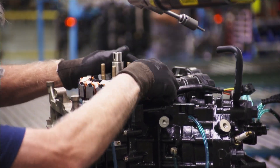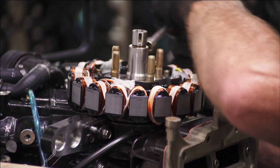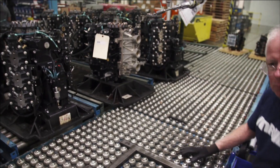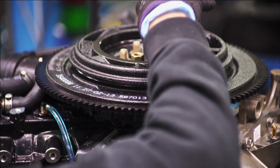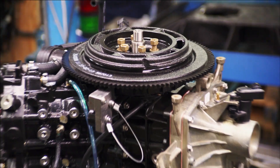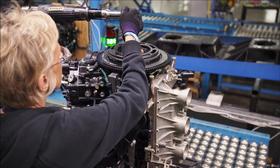Then it's ready for the stator — the stack of steel plates wound with copper that becomes part of the generator. The flywheel is added to the stator; it's a rotating wheel that helps give the motor stability. Our generator system uses permanent magnets in the flywheel. As the flywheel rotates around the outside of the stator, that completes the generator system. The flywheel is then connected to the crankshaft, adding inertia so the engine can come over compression and continue to spin and run smoothly.